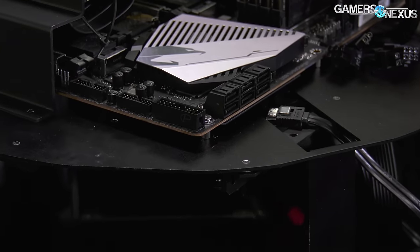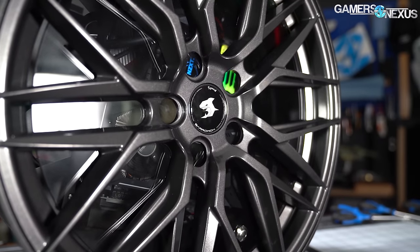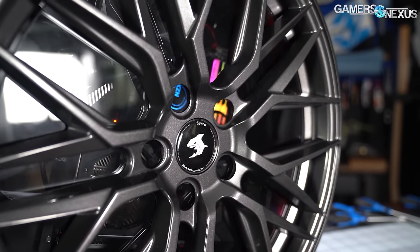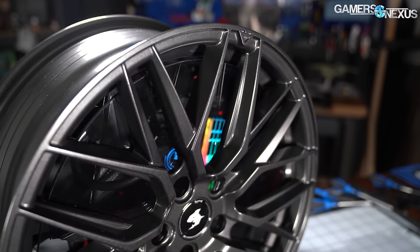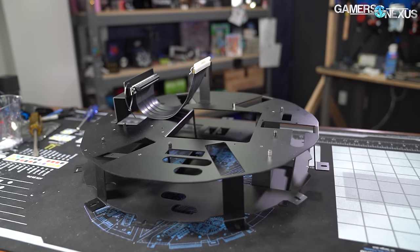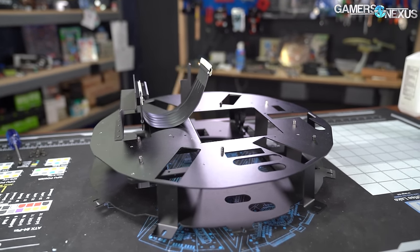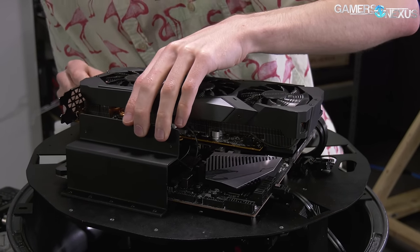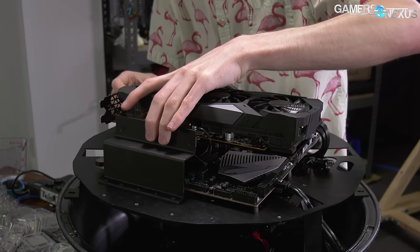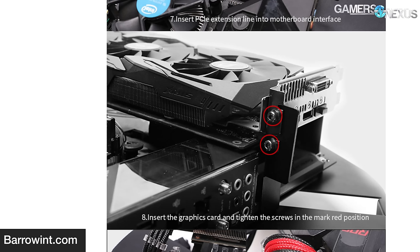As far as we can tell, the end result is exactly the same as if normal screws were used. Standoffs are only placed around the edge of the board, so there's no support for the board at the center. On top of this, the motherboard tray isn't especially flat — the motherboard didn't make good contact with all the standoffs until the screws were tightened down. Because Barrow chose to house the PSU within the body of the case, the motherboard tray is pushed very close to the glass side panel, with minimal clearance for GPU and CPU coolers. Normal width GPUs must be mounted vertically, and there are no PCIe supports for anything else, just riser cables and a two-slot vertical mount. This is the first clue that this case is made exclusively for open-loop cooling, even though they don't advertise it that way. Mounting an air-cooled GPU with the fans pressed up against a glass panel is a terrible idea, as we've proven in the past numerous times. The manufacturer couldn't resist posting some marketing images with air-cooled GPUs, so this is a valid test of a build approach they implied.